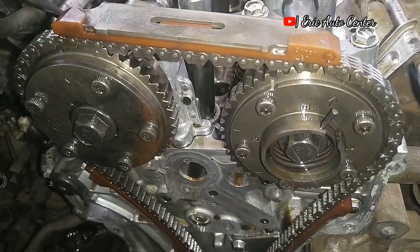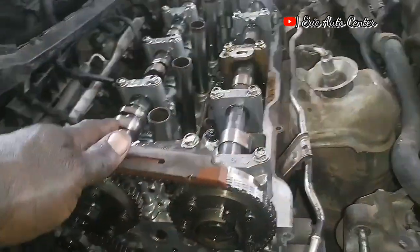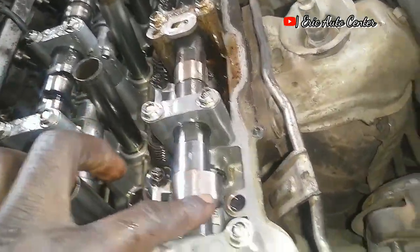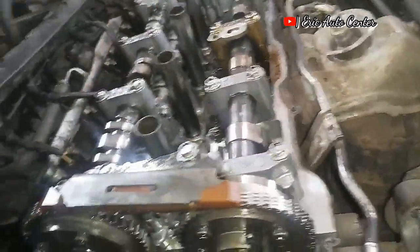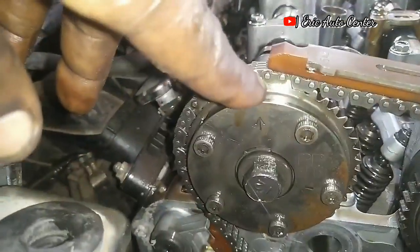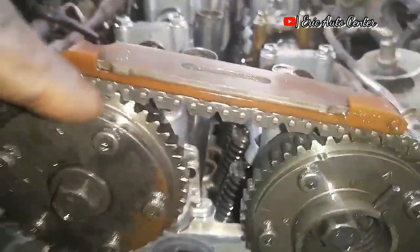Let's get into the timing. We have the exhaust camshaft here, and we have the intake camshaft here. We have a VVT timing sprocket, and also here we have another VVT sprocket. These are the main components for getting a correct start. When you want to set this timing, make sure you get the timing marks correct. There is a timing alignment mark here which will help you know where to position correctly. You can see the two yellow colored links here which indicate where to put the first mark, and on the inlet side there is a deep mark which also aligns to get the correct start.